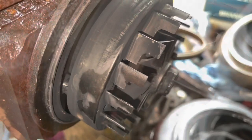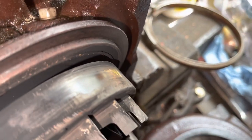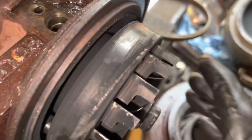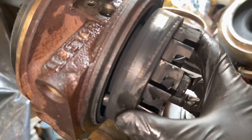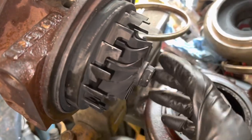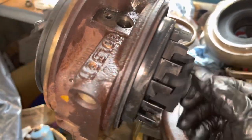If you can see in there, it's pretty dirty. This is getting caught up and that's what's causing the turbo brake and VGT vanes to get stuck when it's warm and in higher gear. If it's cold and it's already got a little binding, when everything expands and gets hot it's going to be worse. We're going to take this shaft out to inspect it.